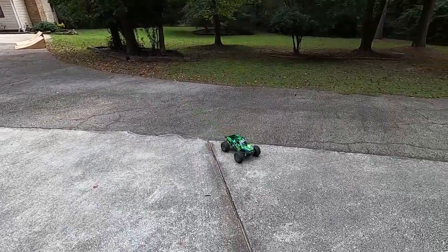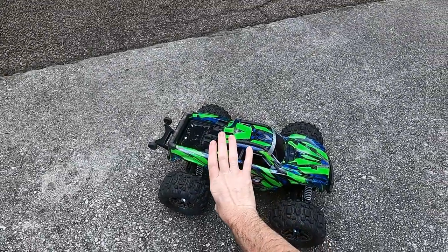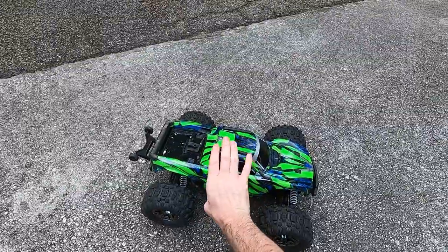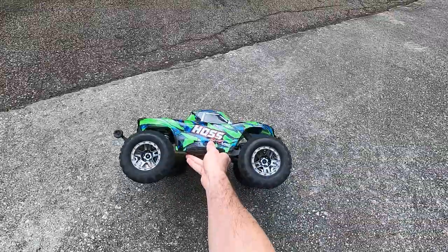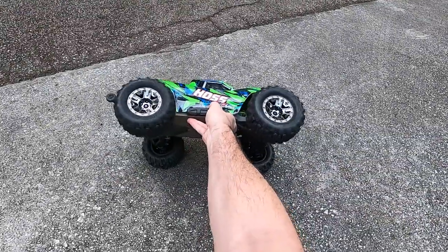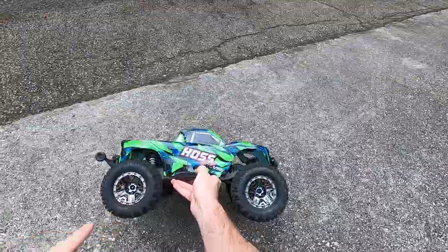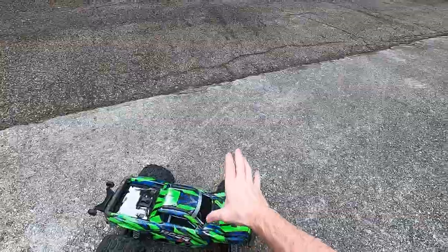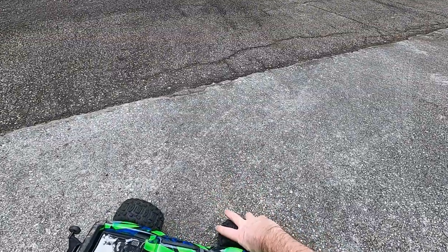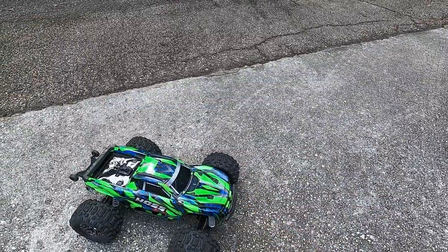And also, before I forget, you need to have either locked differentials or a really thick fluid in your center differential, because what people would do is when they get up on two wheels, they'll pull the trigger trying to get speed, but as you can see, the wheels that are on the ground are not turning. And so they'll balloon these tires out and blow the tires apart. You don't have any power going to your wheels on the ground when you have really thin differential fluid or if you don't have a locked differential.